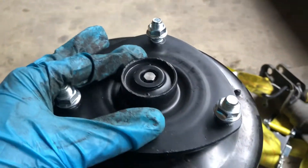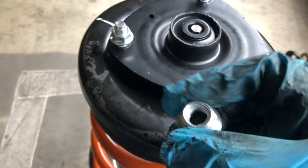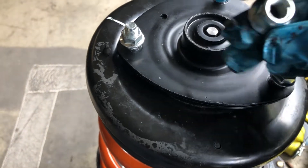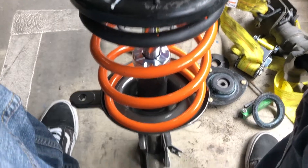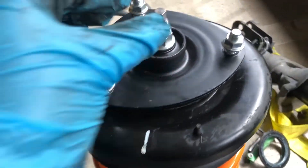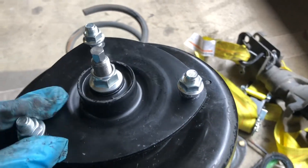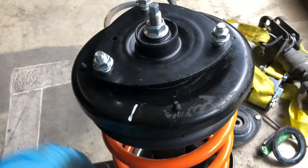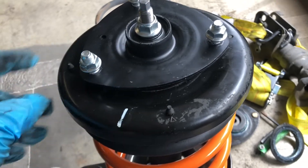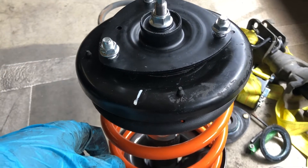Since it's the front right side, I actually have to flip this — it's going to be upside down because that's where the top hat goes and that's where it connects to the strut. I already have it where it should be. All I have to do is apply a little body pressure right here — probably 20 pounds — then pop this on, put a crescent wrench there, and screw it down. Got it all together, this tightened down in literally one minute. Now it's time to fit everything in and put it back.